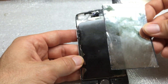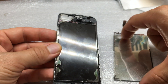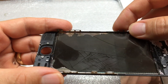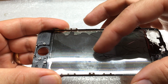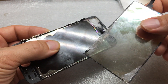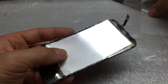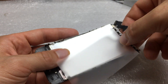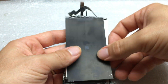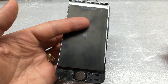The way this broke — probably when it got dropped — is very interesting: the LCD broke away from the front polarizer. This is the front glass here, and glued to the front glass is the other polarizer. So to summarize: you have the front polarizer, the glass, the LCD itself, the rear polarizer, the two prisms or brightness enhancing film, the LEDs with the diffusion film, the light guide plate, and the reflector film. We have just dissected and put back together the iPhone backlight and LCD assembly — hope you enjoyed!